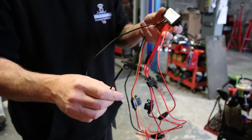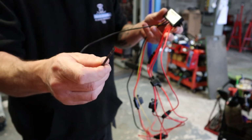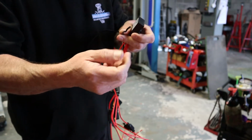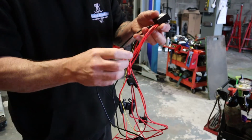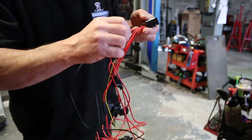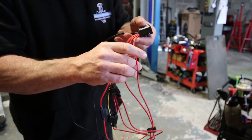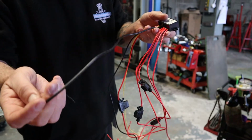Then you buy something else and you want that on this system. So what you've got to do, because you've already wired this one earth into the other 2 things, is cut all the terminals off the things you've wired up, and then put another terminal on the new thing and add it to this original earth. Am I missing something here, or wouldn't it be better if each one of these power sources had its own earth, so it was 5 twin cables coming out? So you'd have a power and an earth for each individual thing, not just one earth.